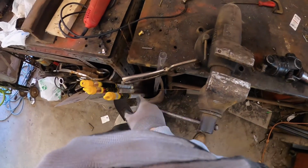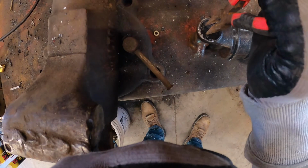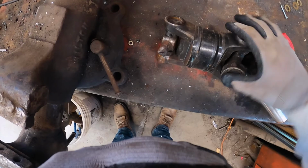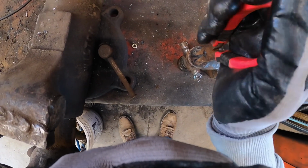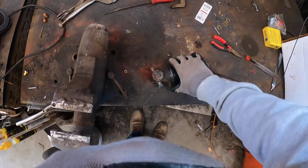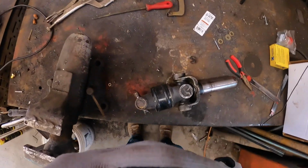You're going to want to first remove your little snap rings. Now, if you're really not careful, those snap rings like to take flight. Now that one came out real easy. There's that guy. I'll take this one out as well, if I can get a hold of that. Snap rings out. Boom. That was easy. Sometimes, if you don't have a needle nose, you can also use the vice grips. I've used the vice grips before. If you don't have vice grips, use your tweezers from inside. Not really, don't use tweezers.